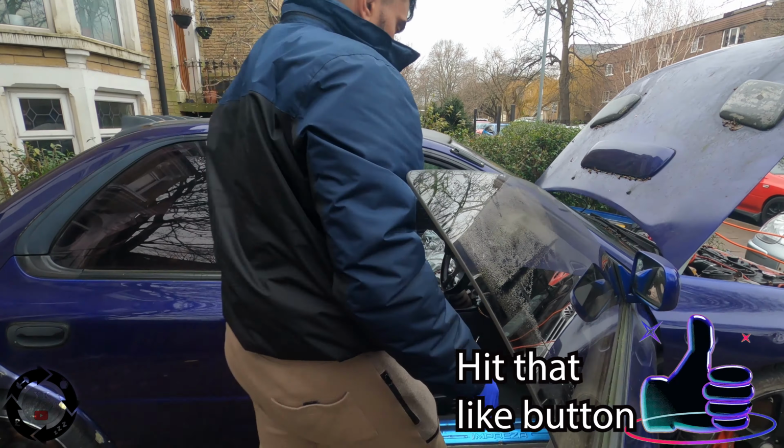This has definitely got a misfire. So what I'm gonna do is I'm gonna spray a bit of electric contact cleaner. This is for electric plugs and stuff. Stay on these plugs. They're really dirty, mucky. Wires look really stiff as well, as if they've been stood for ages. The wires do look really brittle.